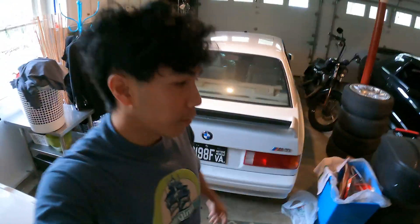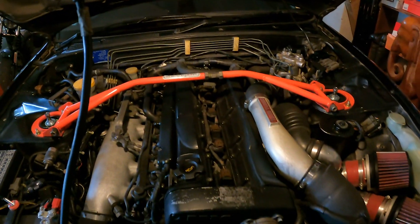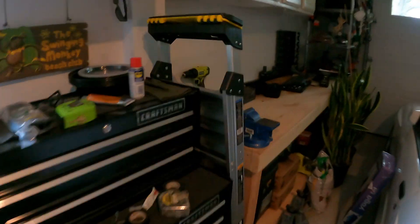What's up YouTube — sorry, my voice is totally going right now, I'm kind of sick, but it's just an update. I just got my M3 back from California, and we have a problem with the GTR — it's misfiring. Pulled up the coil packs and it's basically misfiring on full boost, around cylinder four or five. We got a new part in today.